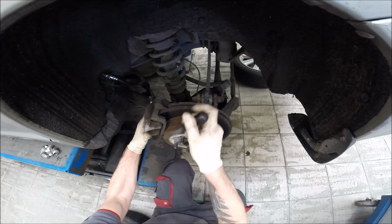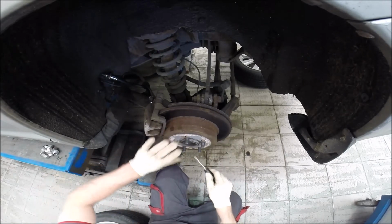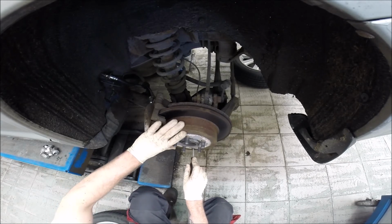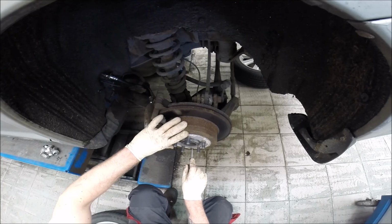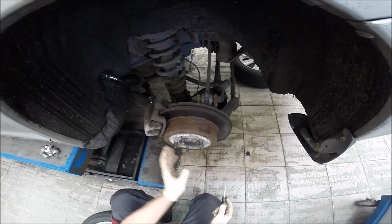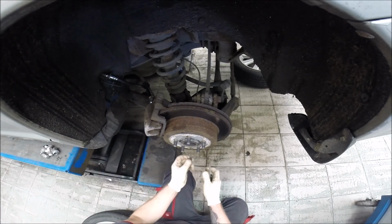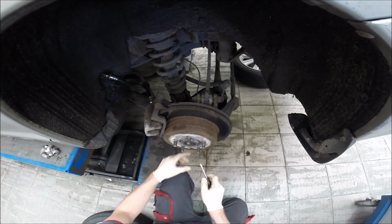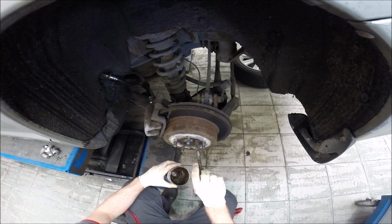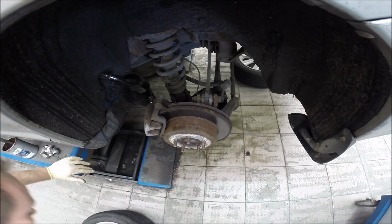You can check as well how the brake pads are wearing, how the brake caliper is, that the brake pads are not sticking. Okay, just put the screwdriver in the hole, move this, you feel how it's catching, and okay, and two, should be fully closed. If it stops moving, release the two clicks, and that's all. Fine, you can grease this place to make it easier to remove the wheel next time. It's the copper grease, always handy. Put the wheel on.